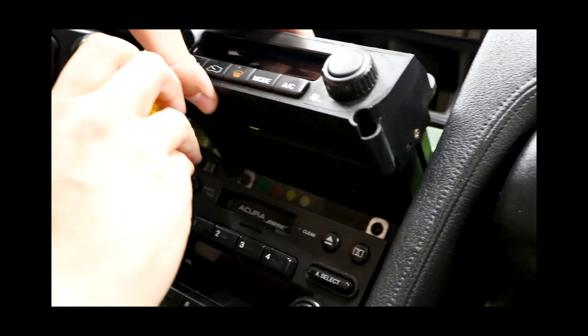I've got everything hooked up and now we're going to go ahead and just slide it back — really easy stuff. If you don't have anyone to hold the radio, that's fine, it's just an additional tip. The thing about installing a radio is you don't want to just slam it back — you want to slowly put it back. If you feel any resistance, that means something is getting bunched up in there and you'll have to take it out, see what's going on, and maneuver it back in.